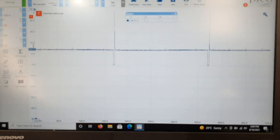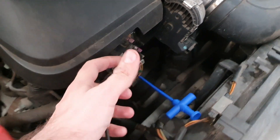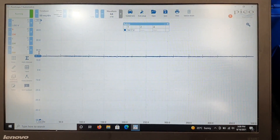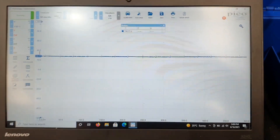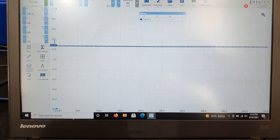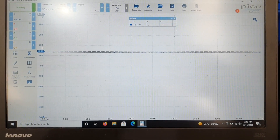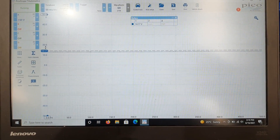On number 3 we've got our grounding pulses — the injector is firing. Switching back to number 5, we've got nothing but battery voltage. By having battery voltage there we've proved that our wiring from the fuse through to the PCM connector is definitely intact. Even with just the key on you can see battery voltage. That one simple test has basically proved the whole system — our PCM should be commanding that grounding, and it's definitely not.